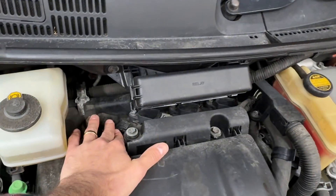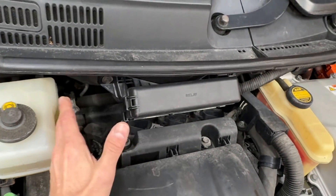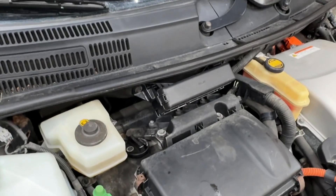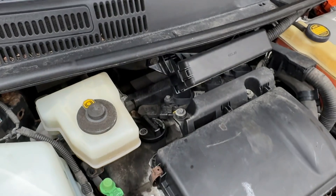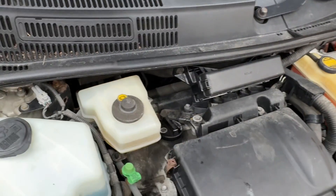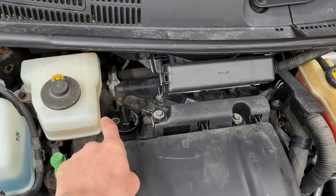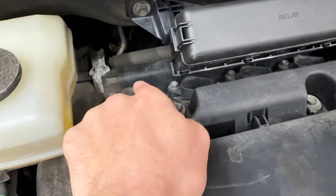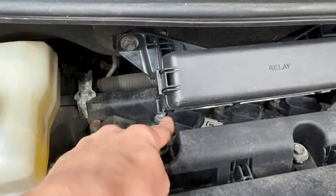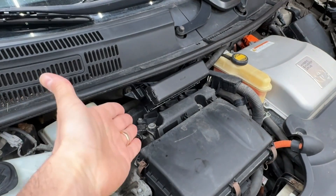Number one: your spark. You might not have a check engine light, and if you do that's something totally different, but spark plugs are neglected. On our own minivan, we got to like 170,000 miles and I never changed the spark plugs — it was running fine, but the tip of the spark plug isn't as sharp as it could be and they're a little bit worn out. So genuine Toyota spark plugs, or NGK, Denso, whatever — there'll be some info in the description. Very easy: you just take out this guy here with these two 10 millimeter bolts, and then there are four 10 millimeters. Unplug these harnesses, pop out the coils, set them on the windshield in order, and just quickly change your spark plugs.